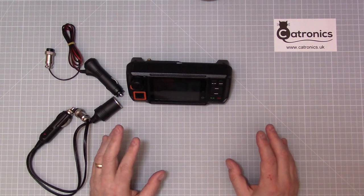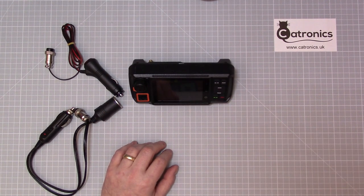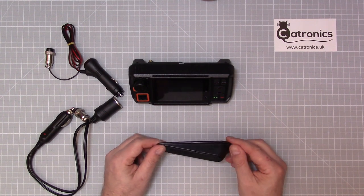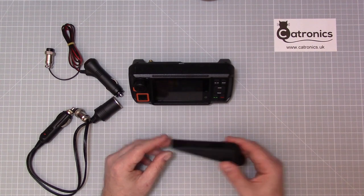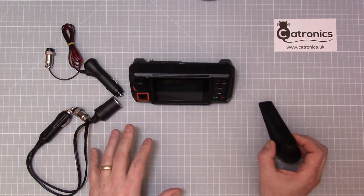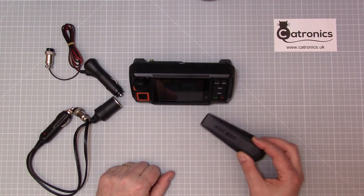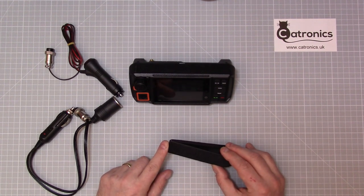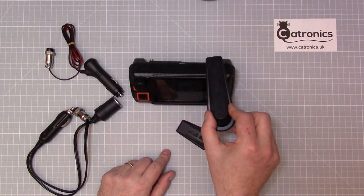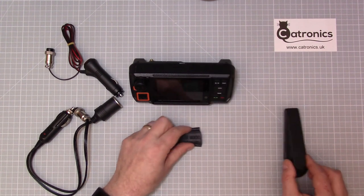In order to mount the rig without using the mobile mounting brackets, one useful tip is to use solid rubber wedges — they have to be the solid rubber ones. There are some very similar ones that will fix the radio into a space on your dashboard, such as where you put keys or drinks. You wedge it in, and we'll show you that later in the video. You would chop these down to size — wedge it in first, make a mark where you want to cut, and use a simple hacksaw to cut them to size.